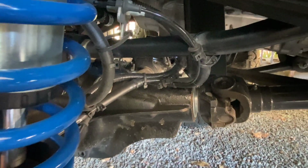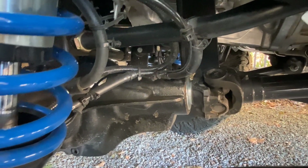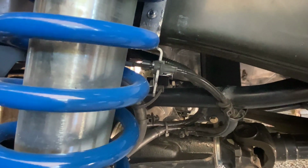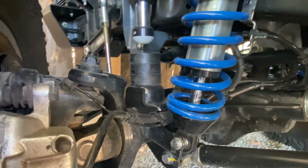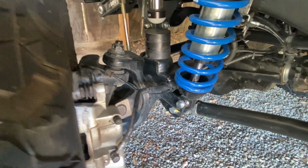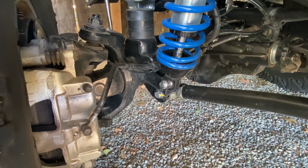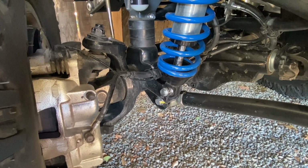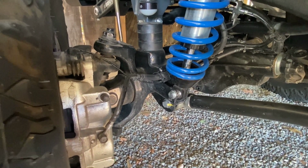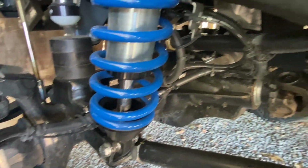And then in areas inside here where it may rub, I've got it covered in that rubber hose. So I just keep an eye on that. And then there's the hard line, where it mates into the hard line. So again, I added 3.5 inches to my line to get a really long brake line, which is not for everybody. You know, the longer the line, the more it has to travel. But I wanted this thing to have an insane amount of flex when it's set up and dialed, and not have my brake line be my limiting factor. So round banjo, and then you can see the ABS line coming out, and I just have that all zip tied together with that. So there's that.